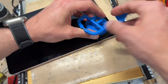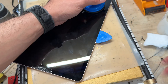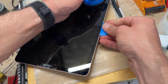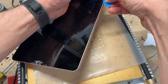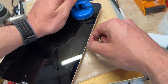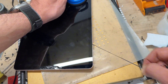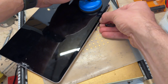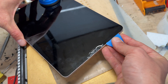I'll add some alcohol where it gets a bit stiffer — if we come into any resistance, just a little bit of isopropyl alcohol. Remember what I said about grabbing all of the adhesive and pulling it out if you can — that really helps, it makes it a bit easier. We're moving on; the screen's nearly come away now and we're just going to carry on working our way around.